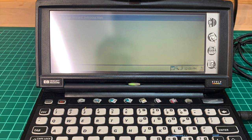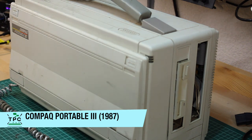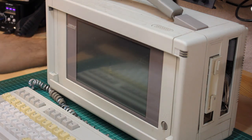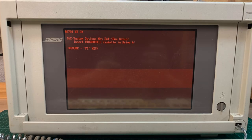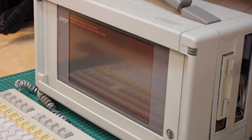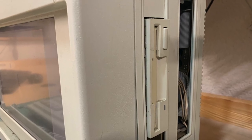This almost feels like Christmas already. And with this heavyweight, I'm coming back to the more luggable-style portable systems. This is a Compaq Portable 2, sporting a 286 CPU and, to my surprise, something over 6 MB of RAM — this machine was obviously heavily upgraded beyond the original configuration. While it still turns on, it won't boot — neither from the floppy nor from the hard drive. Also, the CMOS battery definitely needs replacement.